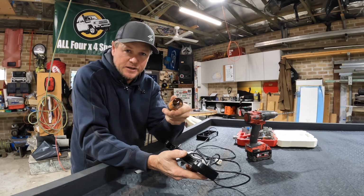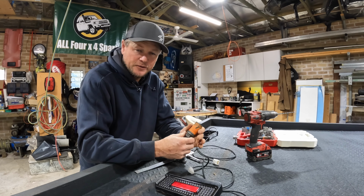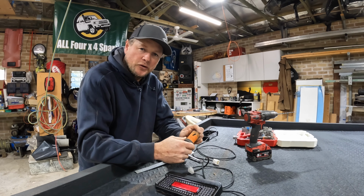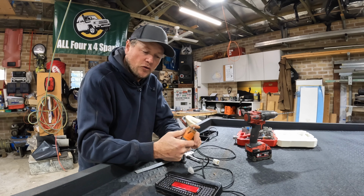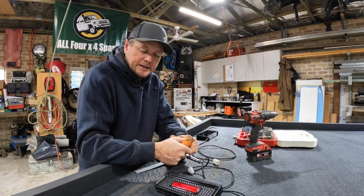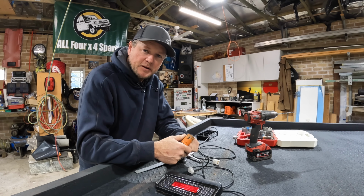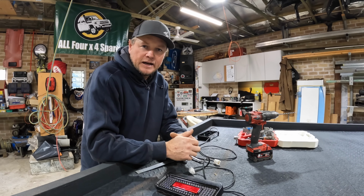I'm going to take the plunge and we're going to drill a hole big enough through the steel for the plug to go through. It is fairly thick steel too, so we'll get the hole saw out, get some cutting compound on it, take our time, and try to get a hole big enough that this will all pass through it without blunting the hole saw, because then I'll have to do another one, and they're pretty expensive. So, start drilling.